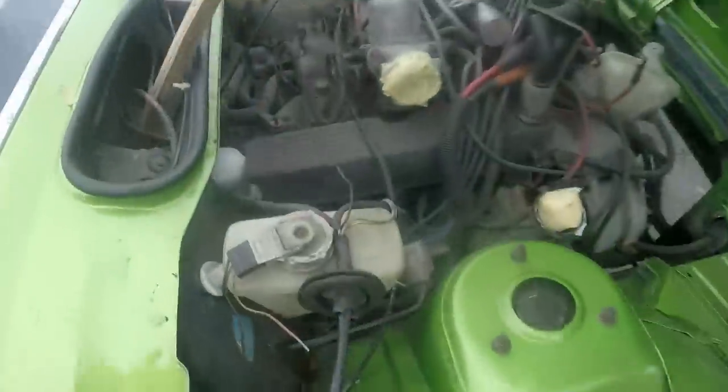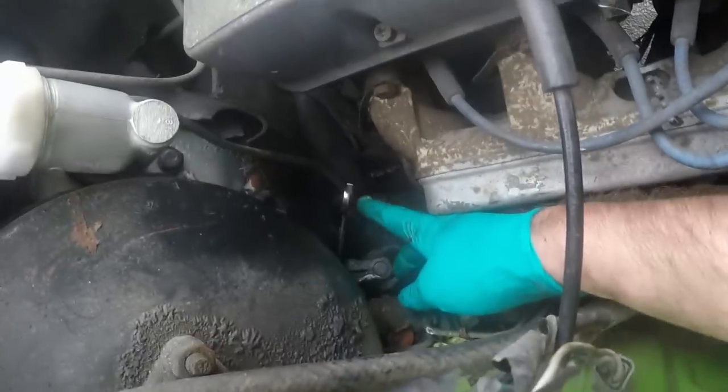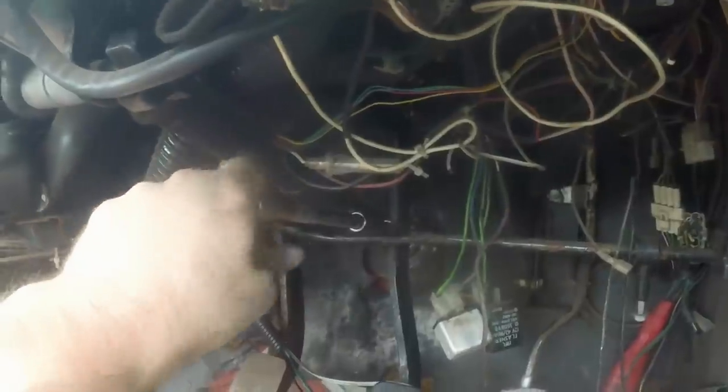I haven't even had a cup of tea yet this morning - it's about 10 o'clock. I'm winning slowly; access is a pain and it involves cutting my arms on bits of metal. The plate is in, the bolts are through, the splines are lined up but not pushed home. I'm trying to get a spanner to balance on the plain nut and lock washer this side while I do it up from the other side, but it's infuriating because it just wants to drop off every time. As soon as the lock washer makes contact between the bulkhead and the underside of the nut, we should be on to a winner.